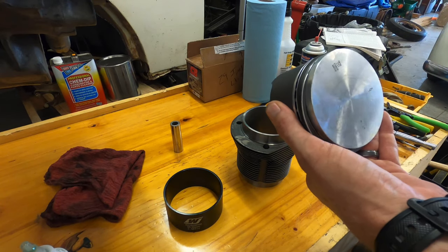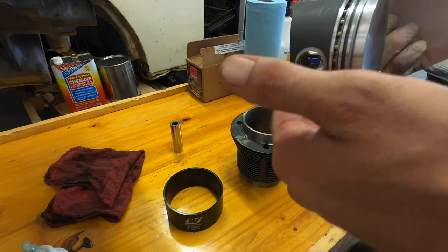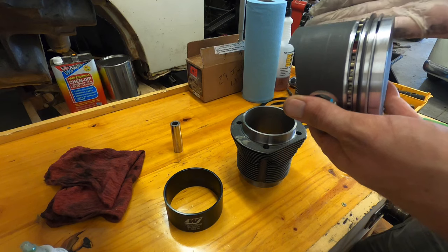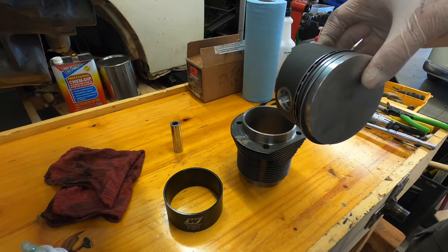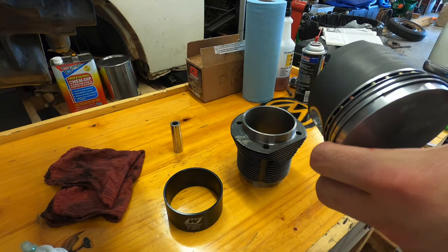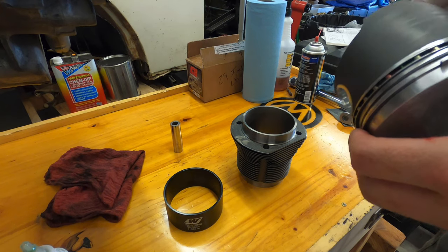The manufacturer instructions say to have everything within 120 degrees, and you don't want any gaps for the piston rings on the lower sides or where the pin goes in. Keep all the gaps spread out from about the 9-10 o'clock position to the 2-3 o'clock position. If you're running a turbo or high-performance engine, you need to do more research — measure the specific ring gap inside the cylinder, because under boost those pistons come together even more, and if they close completely you're going to have problems.